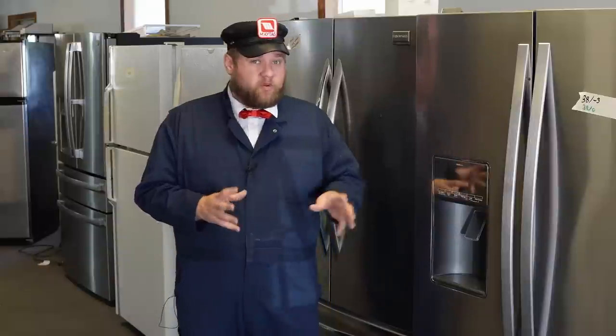One consideration to make on whatever you choose — understand that accidents do happen. Even running a used appliance store for about seven years, every so often we run into circumstances where we've sold a good working appliance that somehow turns bad for the customer. When you go to a used appliance store, you are getting a warranty, and that warranty is just as much for you as it is for us. But do understand that you can have problems that are not caused by a scammer — it can actually be something on your end, sometimes by accident, sometimes by ignorance. With dryers, oftentimes we find that vents are not properly cleaned before we install the dryer, and you could install a dryer that heats but will not dry your clothes due to a restriction in the vents.